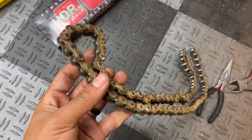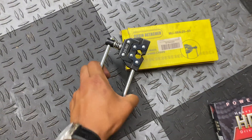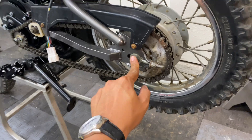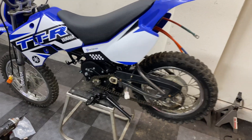I ended up making the chain slightly longer than the stock one. Here's the old rusty chain — the new JT black steel chain is about seven links longer. I just use this chain detacher to take out the links to get the length to the ballpark that I needed, and then I can fine tune the tension with the factory adjustment. If you're interested in checking out any of the items I'm using for this project, I'll leave a link in the description below for everything.